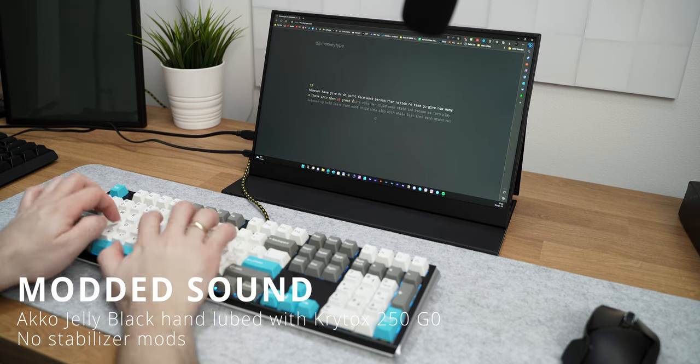It also supports macro recording. Function plus Control for 3 seconds to enter macro recording mode, then select the key you want to program, type in whatever you want your macro to be and press Function Control to exit macro mode. There are a lot more functions, so I will leave a link to the manual in the description, but also some of the features here in the video so you can see them on the screen. You can pause the video and check when and if needed.